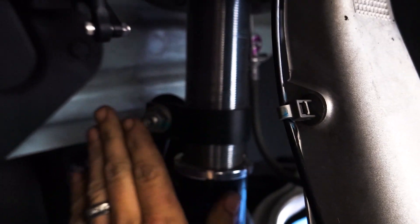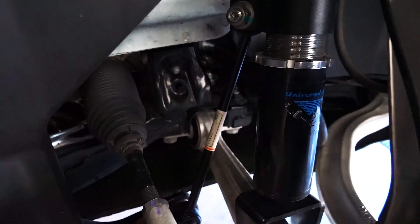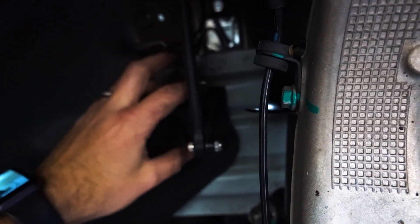My sway bar location is kind of the same as factory, back at about a 45 degree angle. I usually eyeball that down to the corner of the fork and put it about in line with the ball joints on either end. Height sensor wise, this bag does have air in it, so my height sensors have a little bit of room coming down before the stop and then when fully compressed I have a little bit of room above it before the stop.